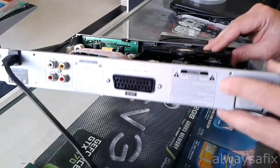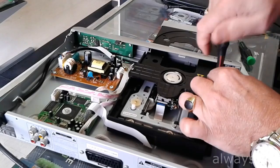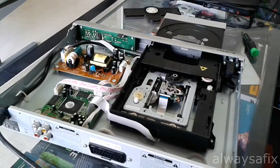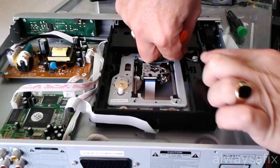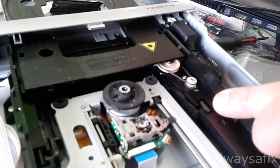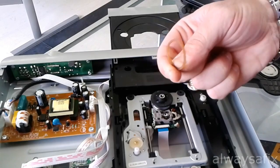To get access, let's take off the top here. I have another belt there. We just need to slide it around the first pulley. I just stretched the band around the big pulley first and then just hooked it onto the motor pulley. If you have problems finding one of these drive belts, you could try using a suitable size elastic band.